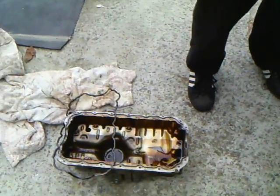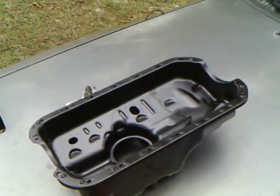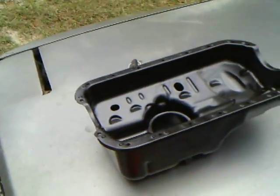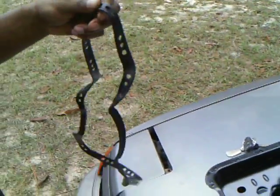That's a '99, 2000 — and usually it's like this for an EX. So we got the DX model oil pan and the lesser. It's a lot lighter too. That's thick aluminum, that's thin aluminum. That's the gasket. You see that? It's a big difference.